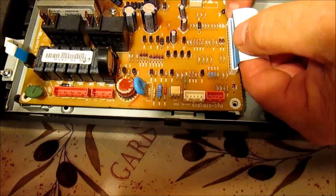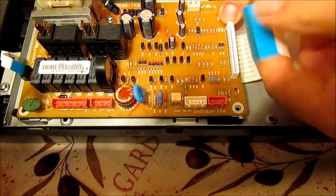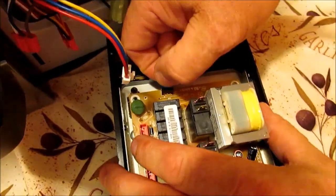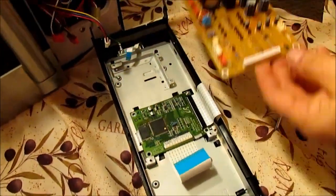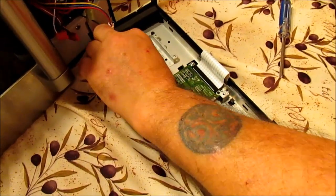As you can see, there's a blue bridge here. What you do is just hold on to the board, put your finger in behind, hold straight up, and pull it back. Do the same thing on this side — hold it straight up, pull it back, and you should be able to remove this whole unit. Lay this to one side, and take your screws out — there's the other screw, and here's the one that fell in behind.